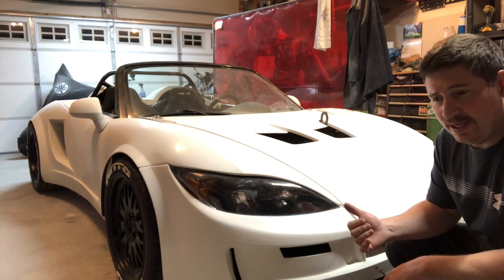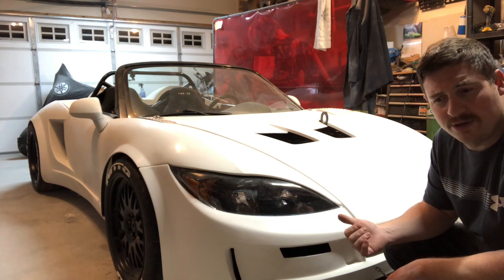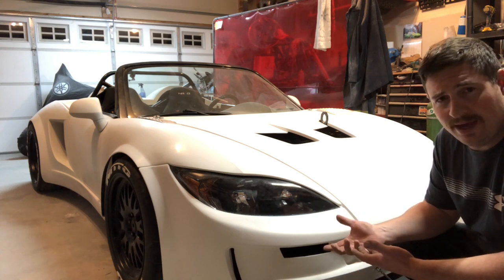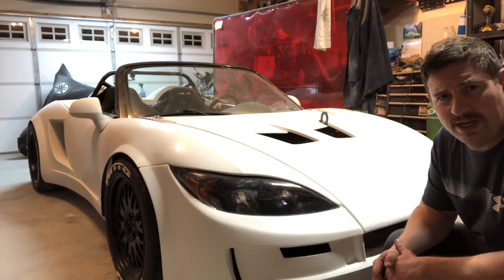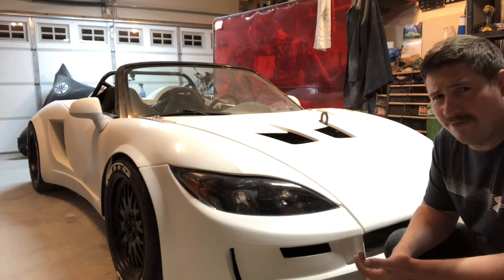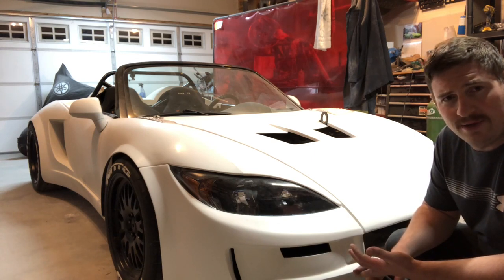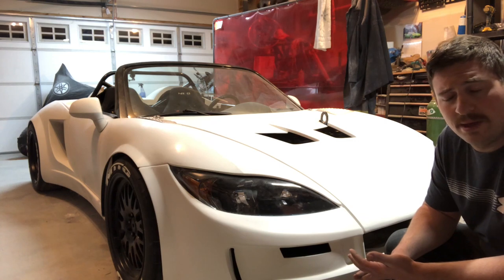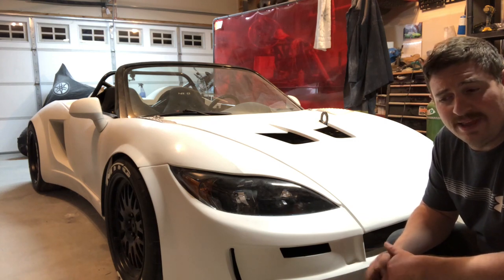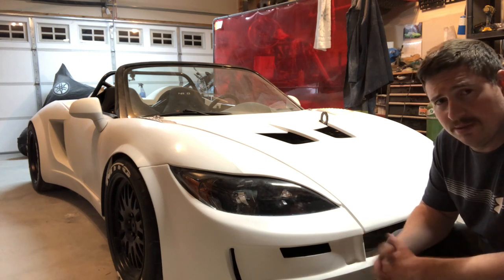I didn't actually tell the Infinity which sensor I installed for the fuel pressure. I used an AEM sensor, and as soon as I fired up the Infinity, it was already reading the 100 psi pressure sensor. So, more accurate fuel pressure. So that can't be a bad thing. And oil pressure. Before I just had a gauge to test, but now I actually have a 150 psi AEM oil pressure sensor. That also registered right away. So I haven't changed anything else mechanically with the engine.